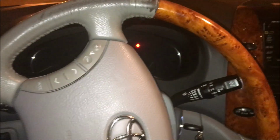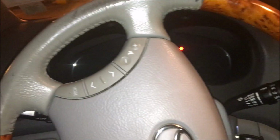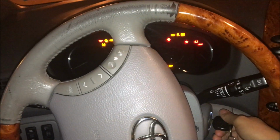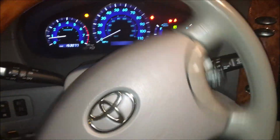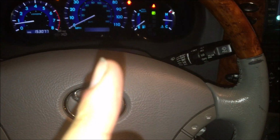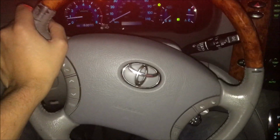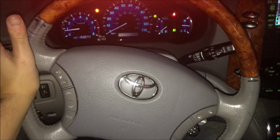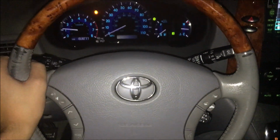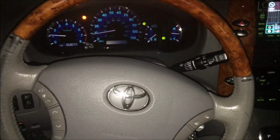All right, so I lined everything back up. I hope the wheel didn't spin too much when it actually spun, but I believe I lined everything back up. It's either exactly right or it's literally one spline away from where it should be. Okay, so as I drive, my steering wheel's cocked like this, and the car's going straight. So I guess I need to turn it back 1 or 2 splines and see what that does. But pretty much this is straight right now.